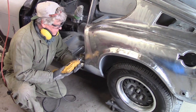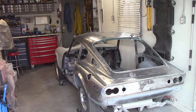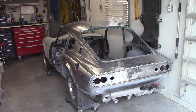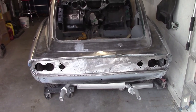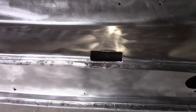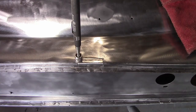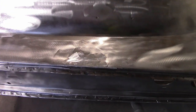This time, we're going to dive in and strip off all the remaining high-build primer and body filler on the shell to see what we're really dealing with here. While looking pretty good on the whole, there was a small section on the rear that required attention. Something sharp and heavy must have made this hole, so it's out with the angle grinder to make it even bigger, followed by welding in a patch of new metal. A smooth off with a flap disc, and it looks more like something we can work with.